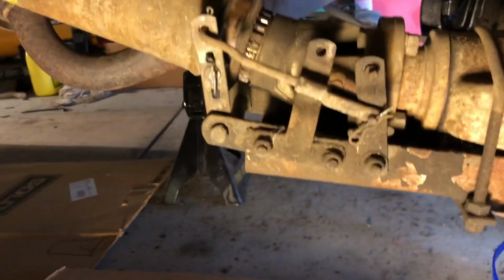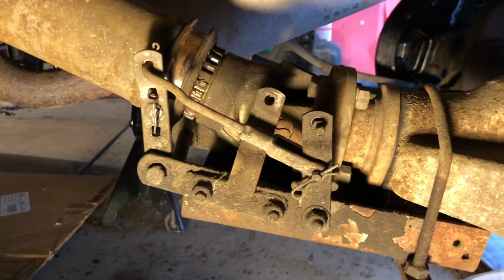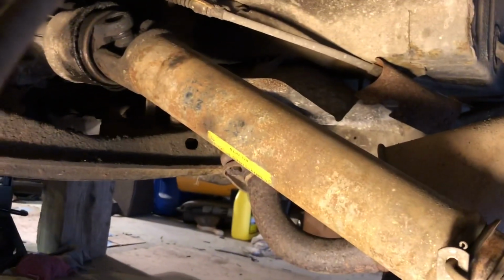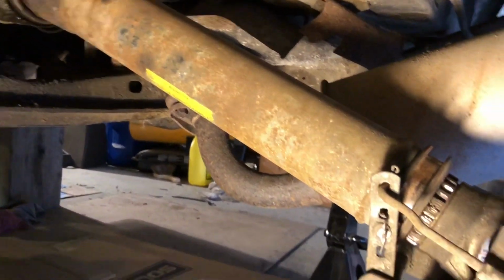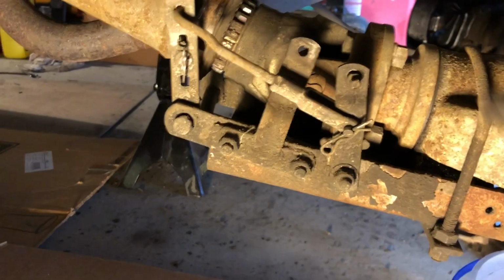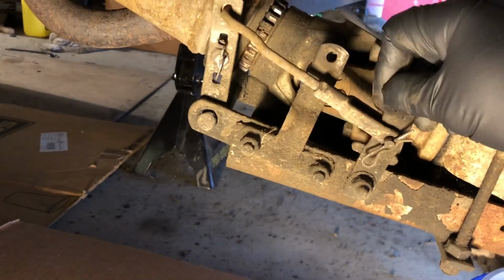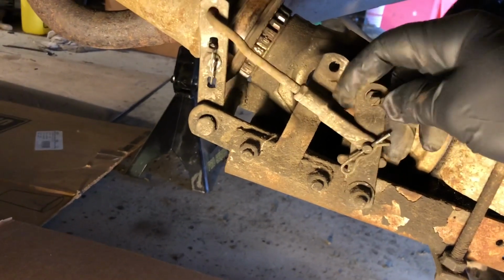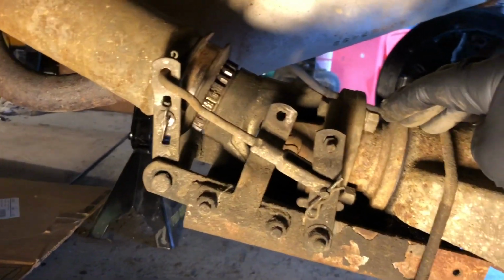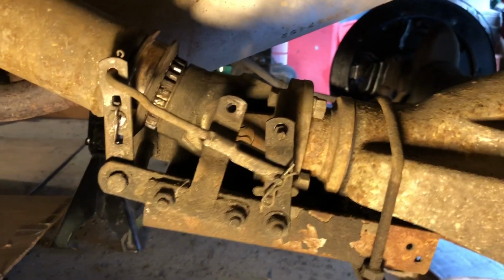It kind of makes me nervous. There's one more link in the chain to perhaps have to service or that breaks. But I don't have the original driveline, so I don't have a driveline to put in here. So I'm just going to reuse this mechanism. I'm going to take it apart and re-grease it. This thing right here slides back and forth and pulls that collar down. But in order to drop the driveline to get the transmission out, I'm going to have to take it all apart.